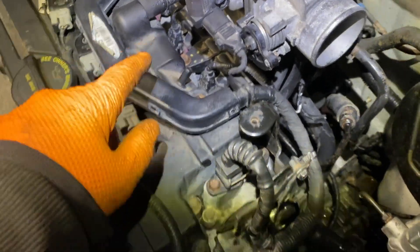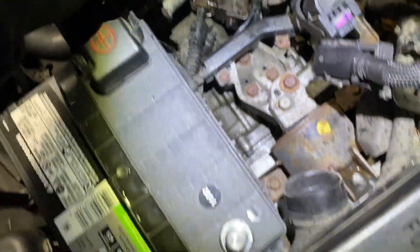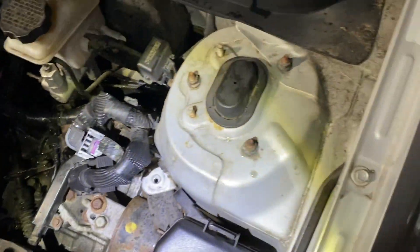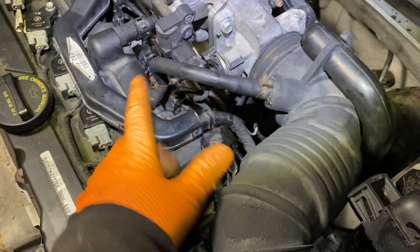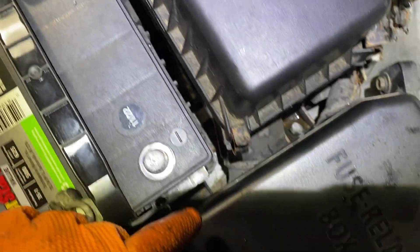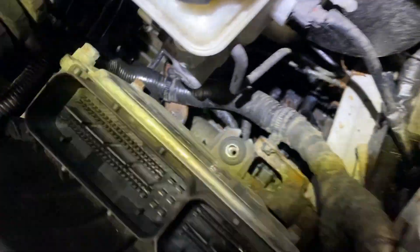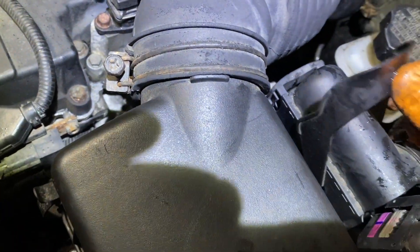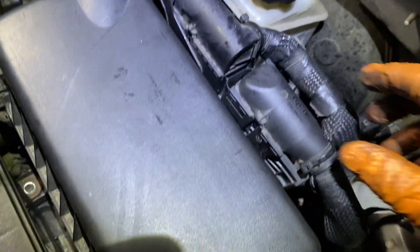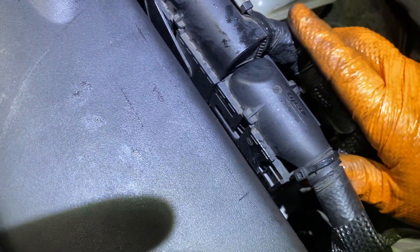The air cleaner goes in here and here is your port. Make sure there's a clamp here and here, then you've got your three 10-millimeter bolts — one, two, and the third one I'll show you. When you put these on, same as before, make sure it goes on straight — you don't want to bend anything — and then slowly it pushes down by itself. Same thing on this one. When you push it, it seats down by itself. That's important — you don't want to bend any prongs there. And then that's it, and you're done.